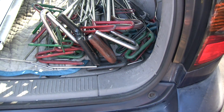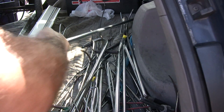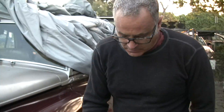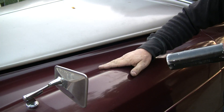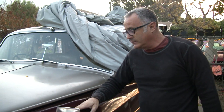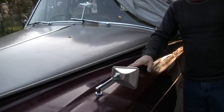So all different shapes and sizes to get into various tight confined spaces — and that's the full kit. You'd bring everything out just to make sure you have it all; I always have them in my car. There are some really long ones too. Not very fancy, but they work. They use a heat gun — not so much to assist with the steel part of it, but for the paint. It gets nice and warm, the paint becomes pliable and won't crack. The dent is basically just pushed up with metal rods. That's pretty much it — just years of experience are what really make it work. I use a light as a source of reference; it casts across the panel and accentuates and makes the dent really stand out, and that's how I see what I'm doing.